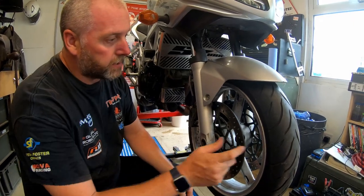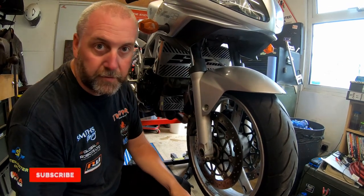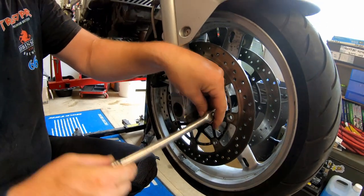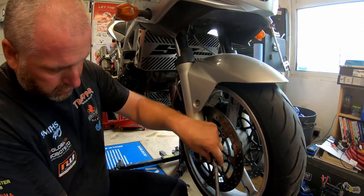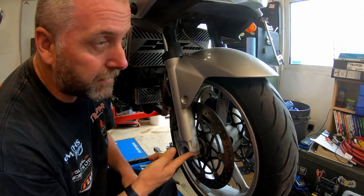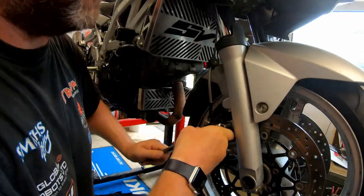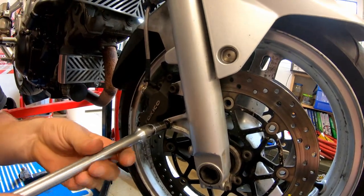What we need to do is drop the front wheel off, take the mudguard off, remove the brakes from the forks, before we can actually remove the fork legs from the yokes. We'll begin with the pinch bolts down at the bottom of the fork legs. These should not be overly tight - there is a torque spec and it should be respected at all times. Over-tightening these bolts can crack the casting at the bottom of the fork, meaning you're looking at a new fork leg.